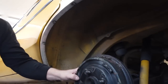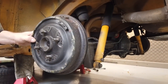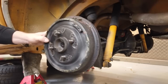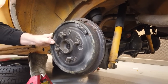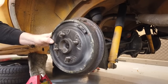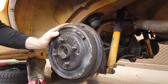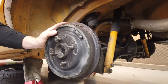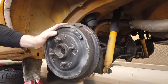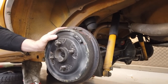there's probably people out there in YouTube land, Cortina owners, or indeed the axle is on, principle of it anyway, is on other Fords. But you hold this wheel here, you turn the other wheel, and you can't turn it. But they do spin opposite ways, so partially the gearbox, the axle is working, but in terms of a diff, it isn't. And that might explain the resonating sound I was hearing on the way back on the M74. So something along the way on the trip to Scotland, the axle has thrown its hand in.